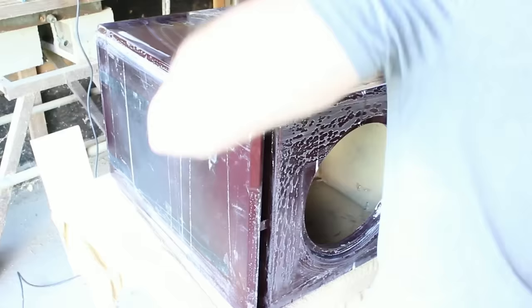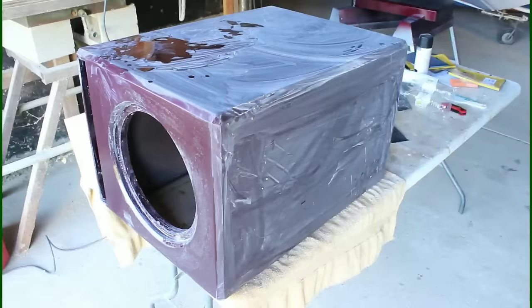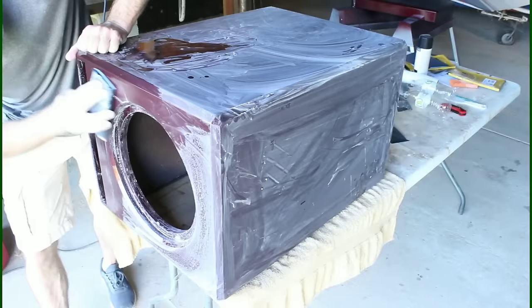But again, as it's drying, you're going to see little pits, and those are the low spots from that little picture I drew for you earlier. So you can tell whenever you've completely removed all the highs and you're starting to get into the coat underneath, where those valleys are. And you want to stop really before you get there. If you see a few little pits, you're not going to see them once we're done. Once we compound and buff, you're not going to notice it at all.